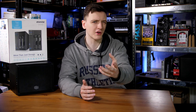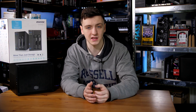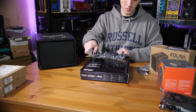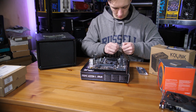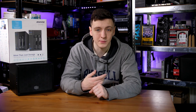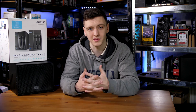Once you have the case sorted you can get an idea for what motherboards and processors you want. On the budget side, something like the A8 I recommended in the setup guide is a fantastic chip at around the £50 mark, and you can pick up motherboards like the A320 board for around £60 that will work perfectly with it — with display outputs, gigabit ethernet, and PCIe slots for 10 gigabit networking adapters. For an even smaller chassis, consider an ITX board like the B350 Gigabyte board, or there are some cheaper Intel ITX options too.